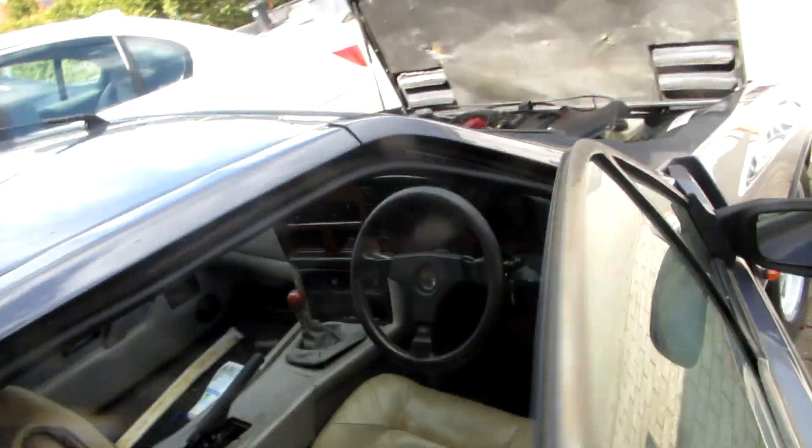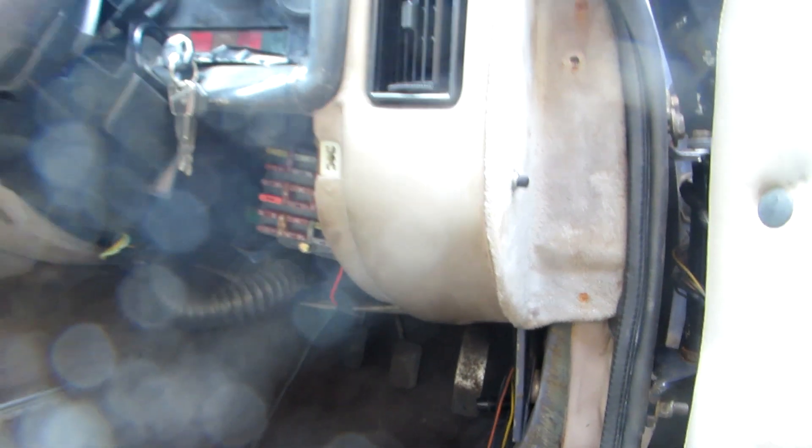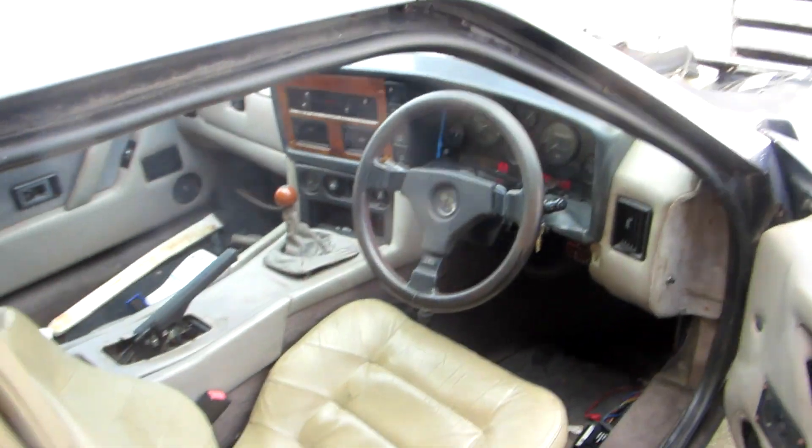I had hoped to be able to move it backwards and forwards a little bit, but unfortunately the clutch pedal is too low and there's not enough movement there - it's not allowing me to get the car in gear. Looks like I'm going to have to take the seat out and start work under there to remove the pedal box, which I've heard is a bit of a pain, but it just has to be done.